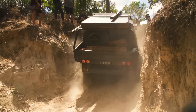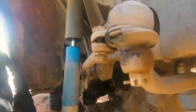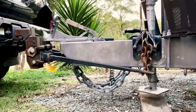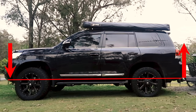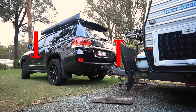It's always best to speak to proper suspension experts — the team at Fulcrum have set up the suspension on all my four-wheel drives and will be able to get the setup just right for your tow rig. Another accessory people often add to help with load levelling is a load distribution hitch. These attach to your tow bar and use high-strength torsional steel bars to help level your tow vehicle and van when towing by decreasing axle load on the rear and distributing it to the front, therefore levelling the vehicle out. They do not decrease the tow ball download — all they do is distribute the weight better across the vehicle, making it more level and safer.